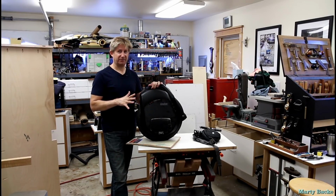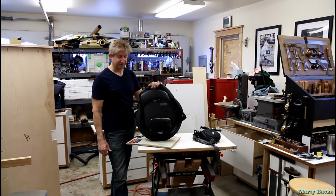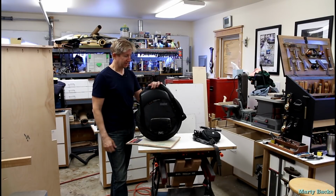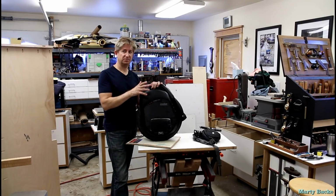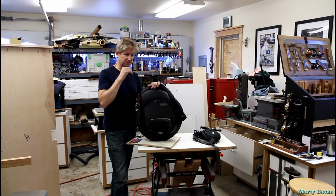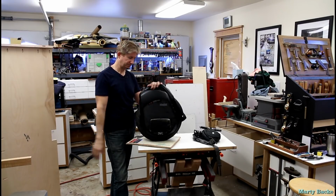I started off with high 30s, and it was very rideable, but very little shock absorption from the tire because this thing was like a rock. Then keying off of what Chooch was saying, I lowered it into the low 20s and rode it quite a bit. And it was pretty rideable, but I was having problems, particularly when I went off-road on trails. It was bad. It would be pulling left and right, whenever it hit bumps and crevices, and just all the time, left and right, awful.